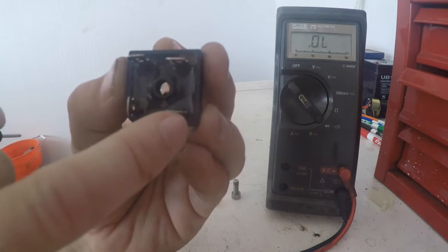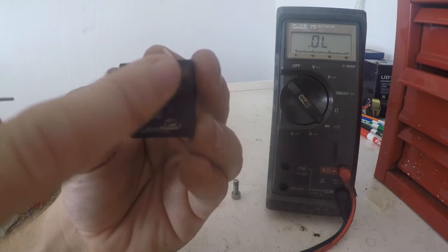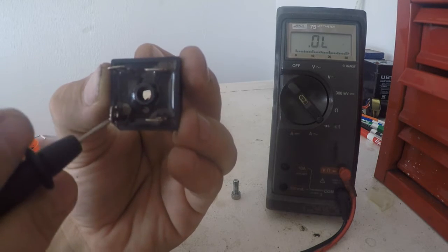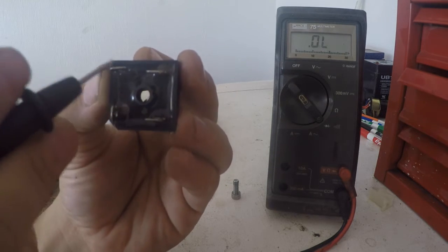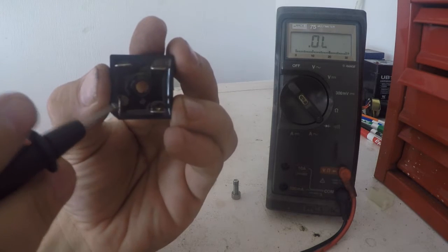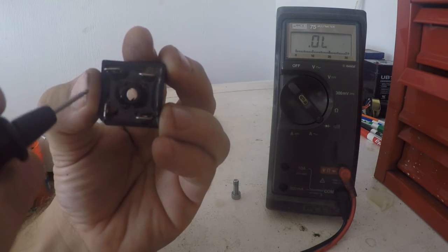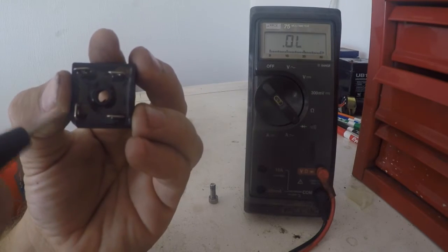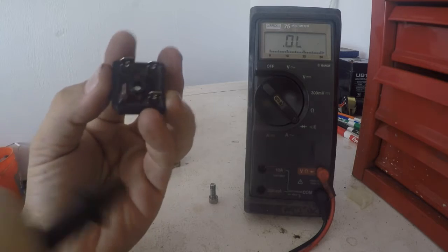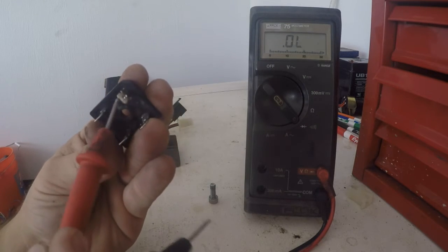The other 3 of these are going to be the wires from your stator. So 1, 2, and 3 come in. There's going to be diodes in between each one of these directing power to only go one way. So it'll go from here this way, here to this way, and so on and so forth. It will not go from this 90-degree lead backwards. You shouldn't get any reading from here to here or anything. You only want power going to this one here. So that being said, if I turn this real quick, this is the 90-degree one up on top.